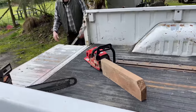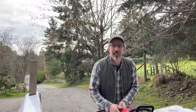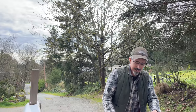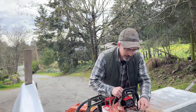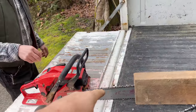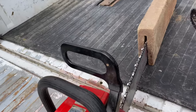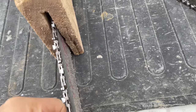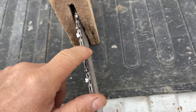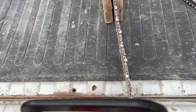No, and that's why you've got to be super, super sharp with those. It's a backyard saw, right? Yeah. Do you need a little warm up on your power saw sharpening? Well, I think I do a pretty good job, but I don't have a raker gauge. And you've got safety chain there. But you look like you got it not bad there. I filed the rakers a bit the other day. The corner's been knocked off this. I've used it since I filed it. Yeah, you can see that.